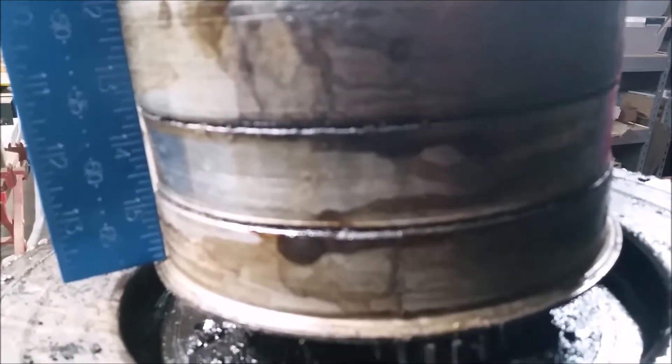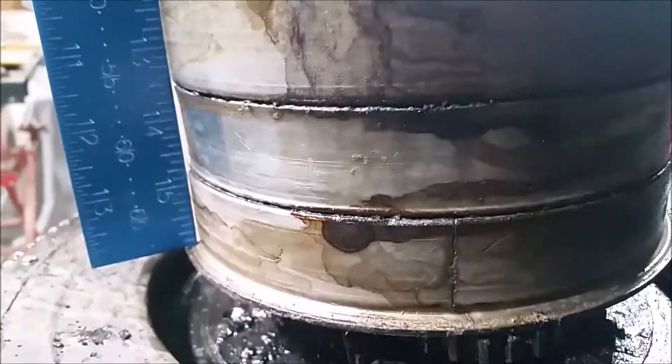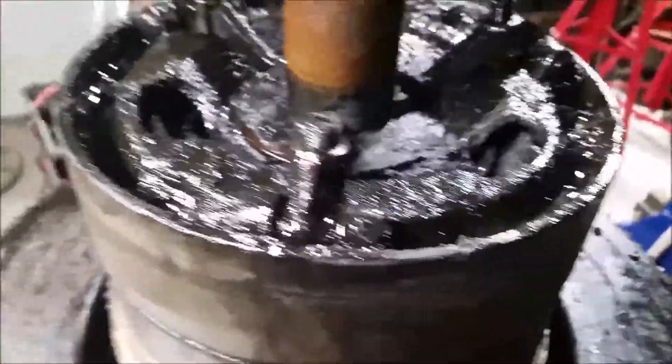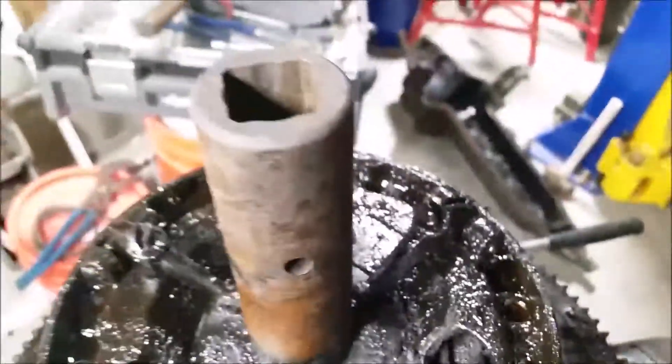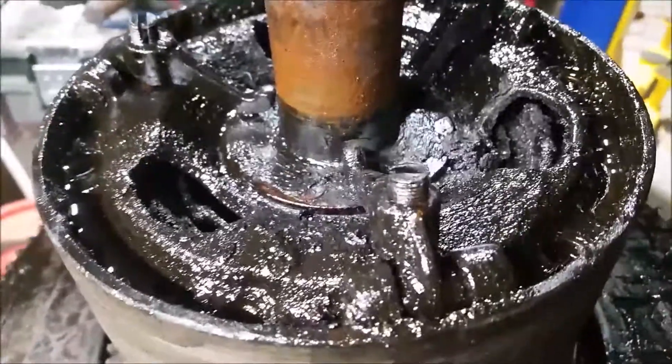The hog's head is off, and I just want to show you how bad that low gear drum is. You can see that gap right there — it's in pretty sorry shape. Now I'm trying to melt through some of this crud so that I can get this hand plate off the disc drum so we can get that apart. I'm going to have to pull this whole thing off. Let that soak for a little bit, and hopefully it'll finally come off of there.